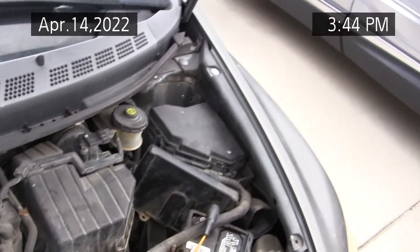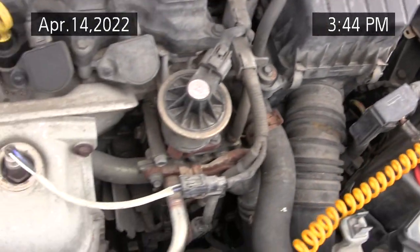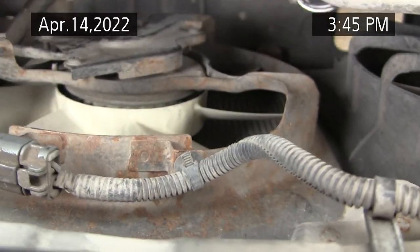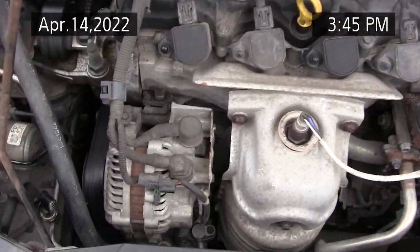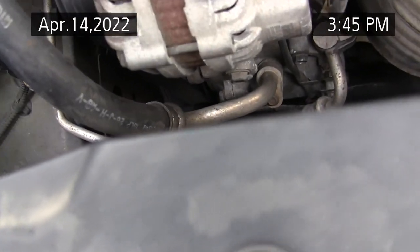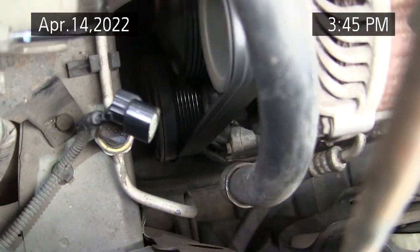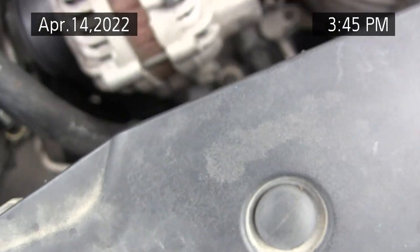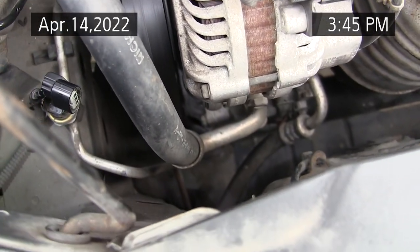Now I've already kind of determined that the problem was the relay. I changed the relay from one place to another, but now I see the compressor fan is not coming on, so I may have just moved the bad relay around. But I'm still trying to ferret out how this three-way switch works. I'm sorry for the bad camera work, but I sure wish I could read the letters on that connector. But of the three pins there, it's the one all the way to the left.